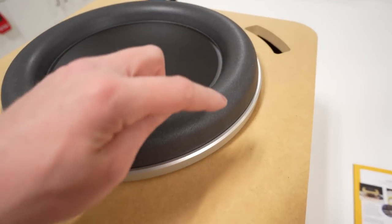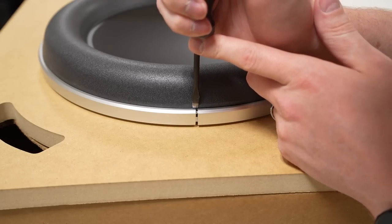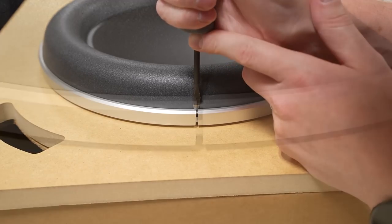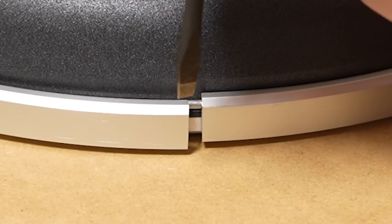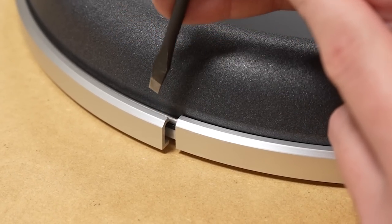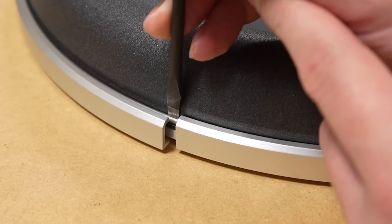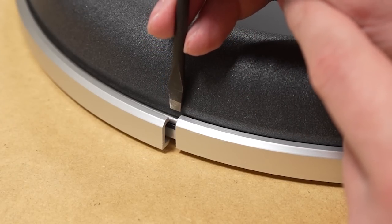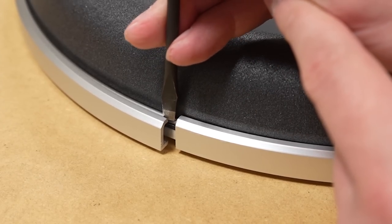This silver piece that goes around the W7 is called the clamp ring. To remove the clamp ring, we're going to use the tip of our flathead screwdriver and push it down between the clamp ring and the foam surround, and gently twist the screwdriver to pop the clamp ring off of the O-ring and frame. This should require very little effort, and if you are encountering a lot of resistance, it's likely because the screwdriver is too far deep in and you're getting behind that metal O-ring. You want to make sure that you're raised above that metal O-ring so that you're only popping off the clamp ring.